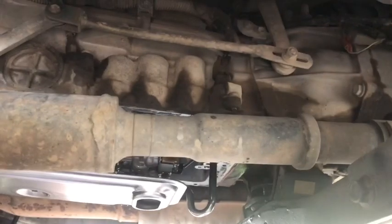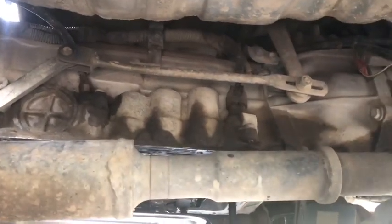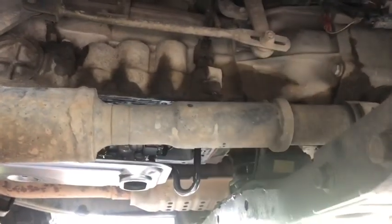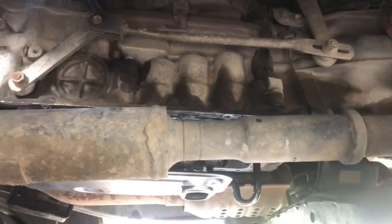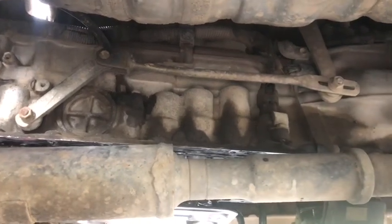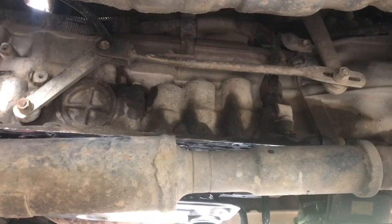so that way it's not slipping, because mine's just slipping into second and it's a pain in the ass. So that's how you do it. You just put it in neutral in the truck, click this lever all the way over, go back twice, you'll be in neutral, and then tighten that bolt back up and you've adjusted your linkage. So I'm going to do that too with a friend of mine once he gets back from the auto parts store. He made a run for me, so that's how you adjust it. Just a heads up so you guys know.